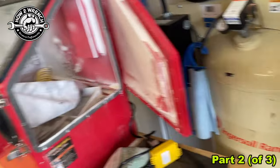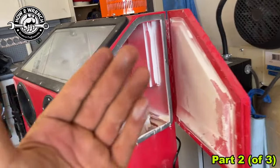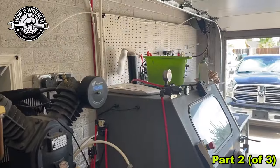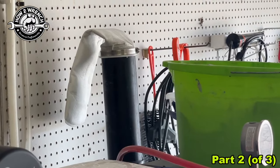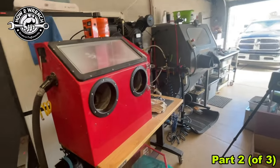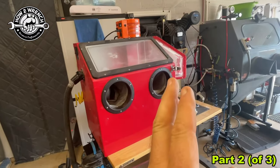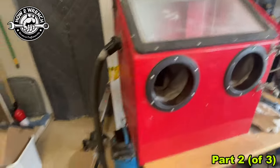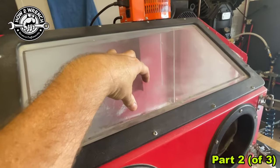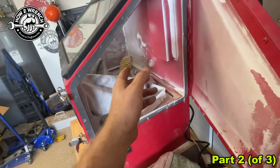That should help understand how that would happen in a space that's under vacuum — it's because of the air pressure that you're adding in there. I've experimented with some different thicknesses of filters, just duct taped on there. I've decided I'm going to do something like my vapor blast cabinet where I'm going to have a piece of PVC with a tube stock on there — same size so I've got multiples and some inventory. Here is the problem: the amount of restriction you put on there and the strength of that vacuum — if you don't have it balanced, it'll literally try to suck the glass down, or it's going to suck all the media right out of the cabinet through the vacuum.